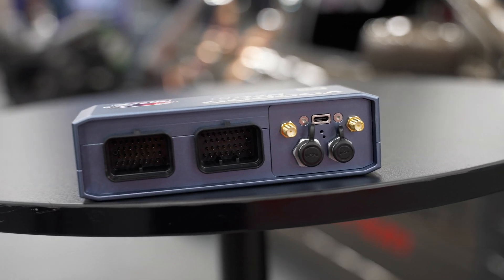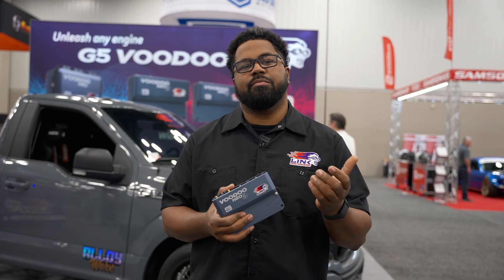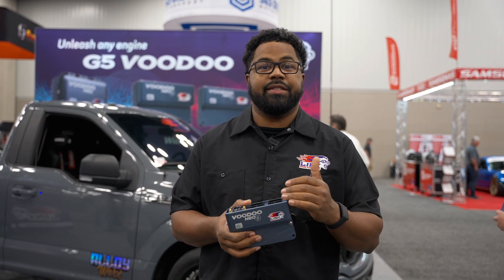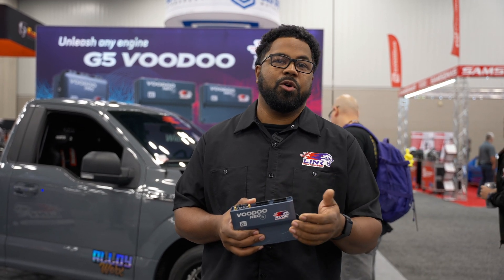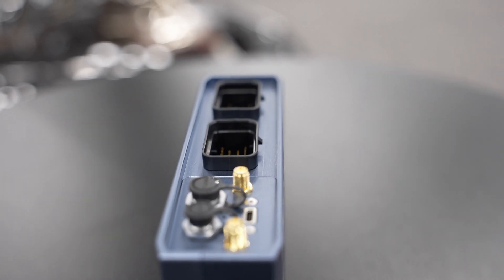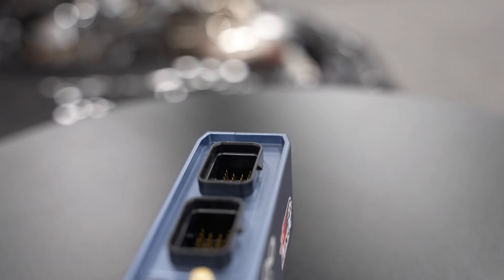That's something a little different from our older ECUs. Another cool feature about the NEO is that it has multi-function input and output pins. What that means is that there are some pins on the ECU that could be used for either an input or an output. So if you have something you want to use as an auxiliary output, and then you change your mind and want to wire it a different way — you want it to be an analog input — you can do that.